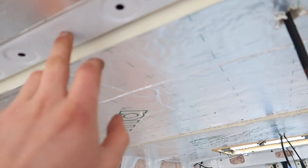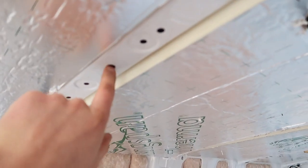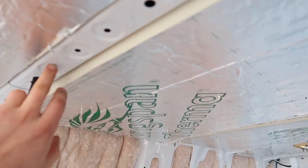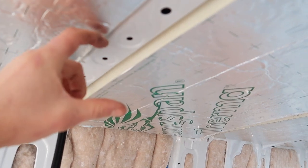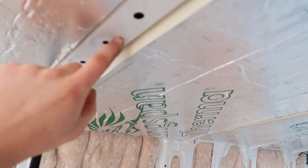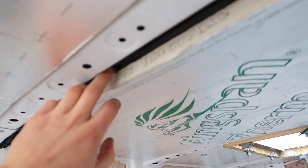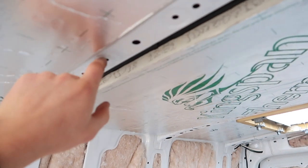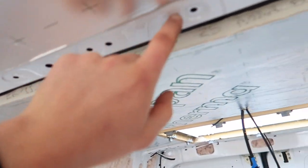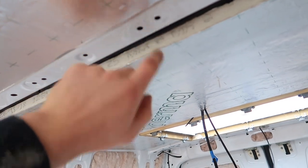When you're putting your nozzle in here, you do get the extension nozzles, but make sure you don't squirt too much expanding foam because it can expand and push the panel away from the actual structural member. Do a test - see how much the expanding foam actually expands, because some expand at different rates. Only put enough in to fill the actual structural member cavity and you should be good to go.